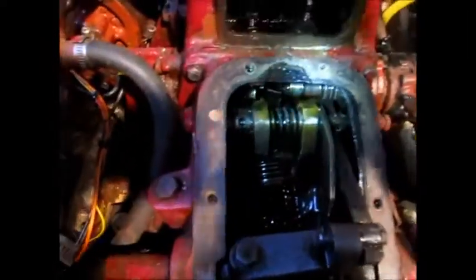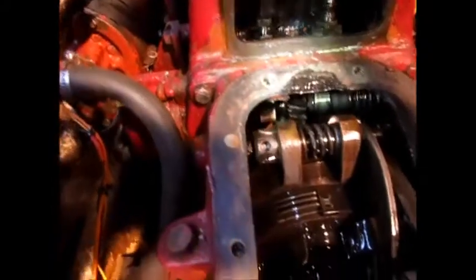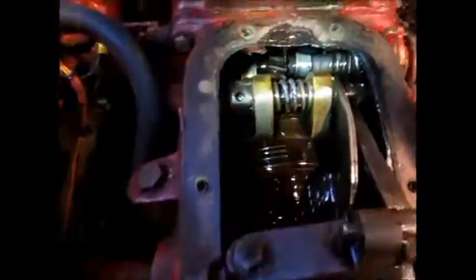I'll put it back in neutral. The brake frees up, and that's the only thing that you can control — these two adjustments here can be controlled by this nut. It's hard to enforce the brake at the right moment, so it comes nicely loose at the moment in neutral. There should be some play here, which there is, as you can hear and see.